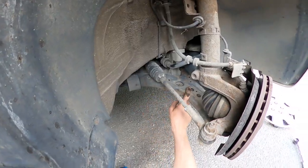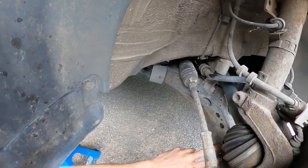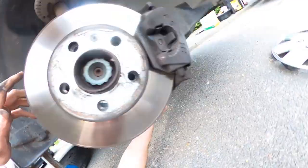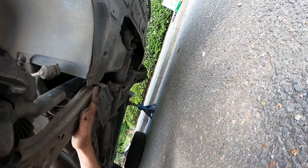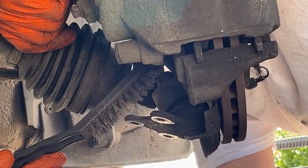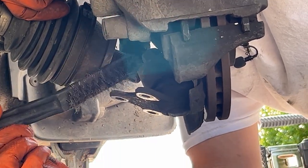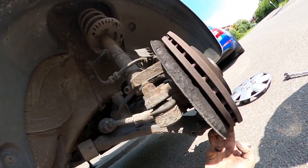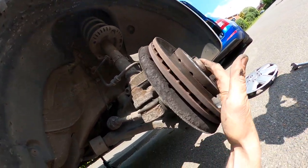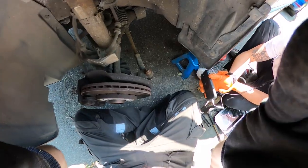The car's in the air. This is the wishbone suspension we're going to change. We've got the large rear bushing here, and the front bushing is actually part of the wish arm itself at the front where it attaches to the hub. We're just going to take this nut off here and then hopefully break the ball joint seal without a ball joint separator, but if necessary we can get one. We've already undone the nut bolt there.